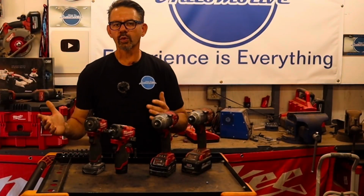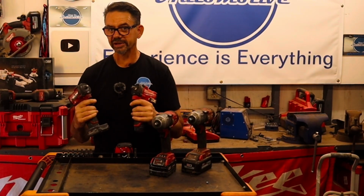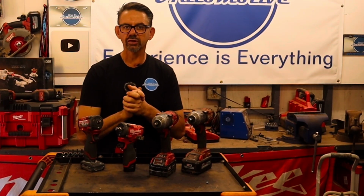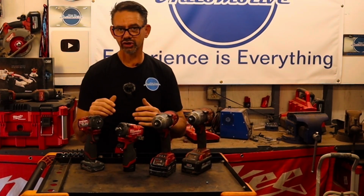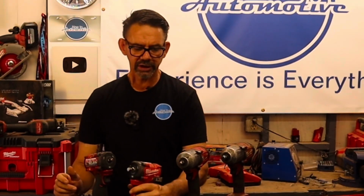Like I said, the number one question on the channel is, should I buy the 3/8 drive or the 1/2-inch drive? And it's not a cut and dry answer. It's always going to depend on what type of work you're doing with the tool. If you're working on heavy truck, like I work at a heavy truck shop, I tend to use a lot of 1/2-inch drive tools, especially in the mid-torque, high torque, and so on.